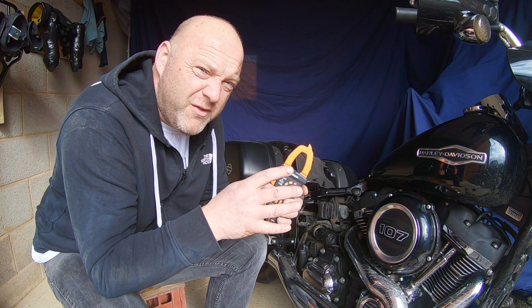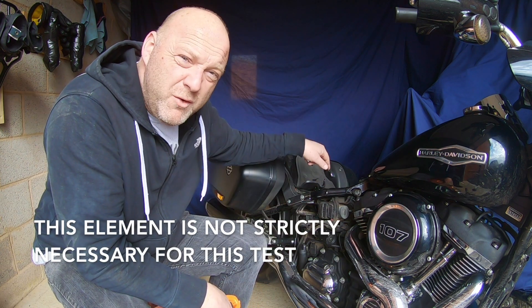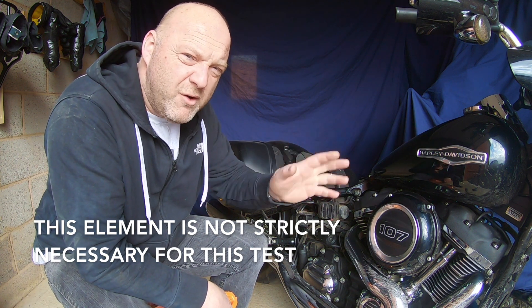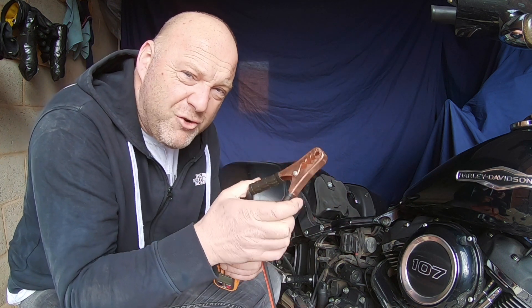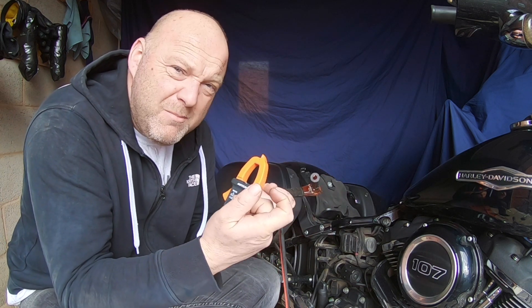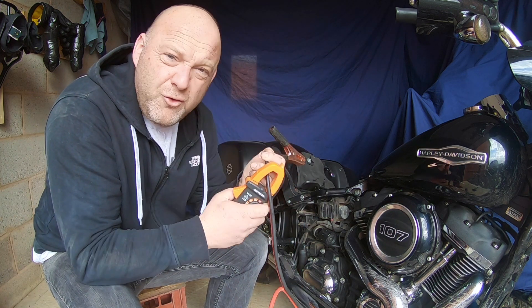For this motorcycle I'm going to try to find a way to bypass the whole removing-the-battery process to make it easier. What I'm going to do first is remove the main fuse on the other side of the motorcycle — always do that if you're ever working on your bike. Then I'm going to disconnect the negative terminal off the battery, leave the battery in situ, and use heavy-duty jumper cables from the battery terminal, connecting up to the negative cable on the motorcycle — basically just extending it. Then I'll measure the current draw through that cable.